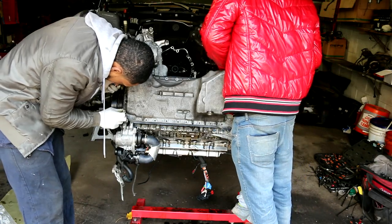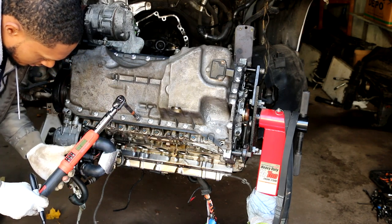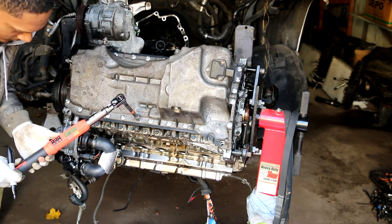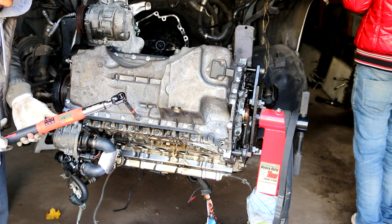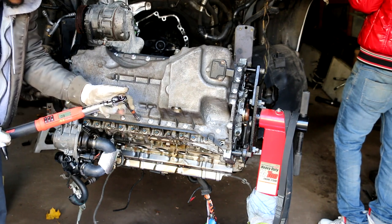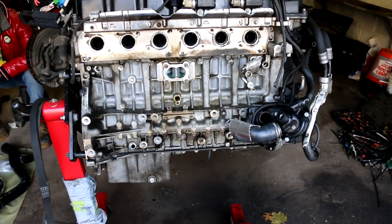Screw them in hand tight. It started counting right away so we're good — we can use the Snap-on. 16 degrees, 27, 30. As we approach the target you're going to slow down. 60 degrees. Now I'm gonna color in the head of this bolt, looking at the exhaust side of the cylinder head.